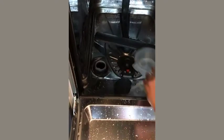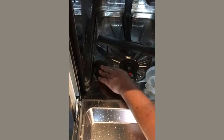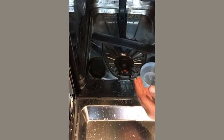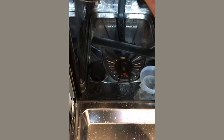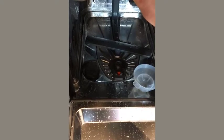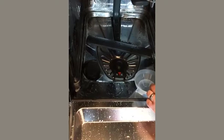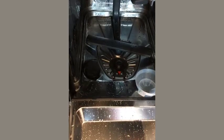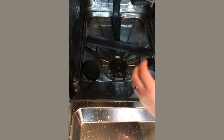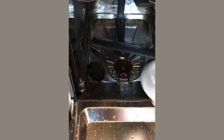You then release, put the cap back on, making sure it's securely fixed, and you must run the machine through a cycle before you actually load it with anything. You can run it through an eco-friendly or a rinse cycle, but there will be a salt residue. Any salt that's overflowed will taint items in the dishwasher if you load it at the same time. So it's important to run a cycle after you've refilled the salt or during first operation.